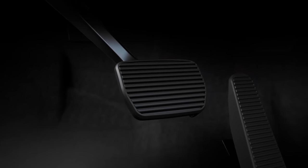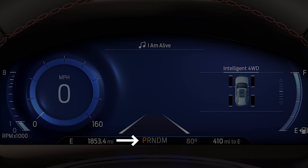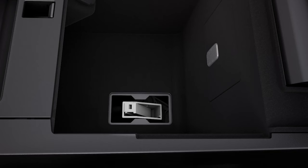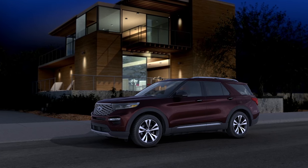With your foot still pressing on the brake pedal, start the vehicle and confirm that the gear selector is in park and the instrument cluster indicates park. If you don't see the park position displayed in the instrument cluster, or if you see a 'park not available,' 'transmission not in park,' or 'shift system fault' message, apply the parking brake and confirm that the manual park release lever is in the lowered lock position. If so, apply the parking brake and call your dealer for service.